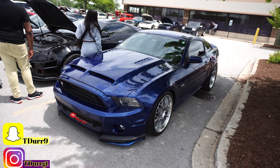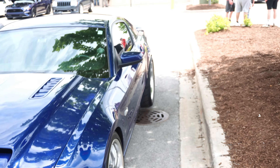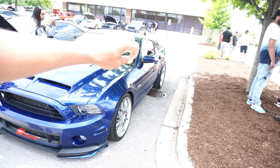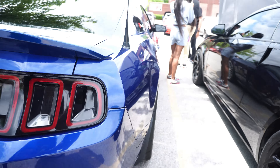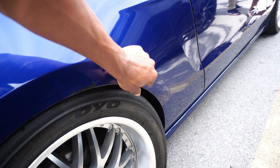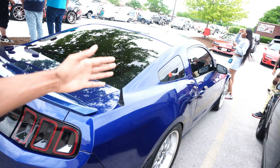Boy bringing you some Cars and Coffee action. As you can see we got blue genie right here posted up. Look at that wide backend right there. As many of you noticed, the driver's side is actually poking out a little bit more. The panhard bar — I gotta adjust my panhard bar because on the driver's side it's poking out more, whereas on the passenger side the tire is not poking out whatsoever. I still have not addressed the rubbing situation or the panhard bar, so I gotta adjust the panhard bar.